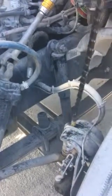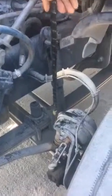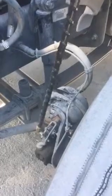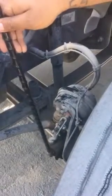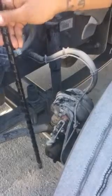The clamp going around my brake chamber is not dented, cracked, broken, or illegally welded; tight and secure with a full set of nuts and bolts. In the back I have my push rod and my slack adjuster. Making sure they're not dented, cracked, broken, or illegally welded; in the proper position and secure with their proper cotter pin. If I were to have more than one inch of play while my brakes were off, I would get a 9/16-inch wrench to my adjusting bolt, do a full swing clockwise until it stops, and a quarter swing counter-clockwise. If I were to adjust this brake chamber, I would adjust the rest so I could brake evenly.